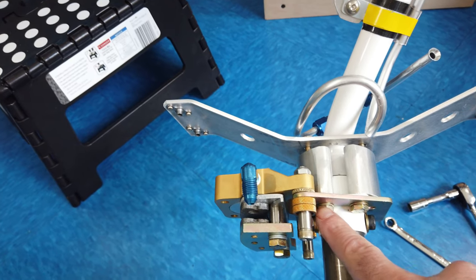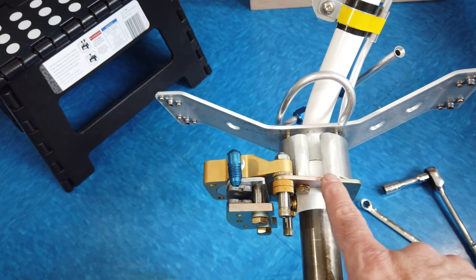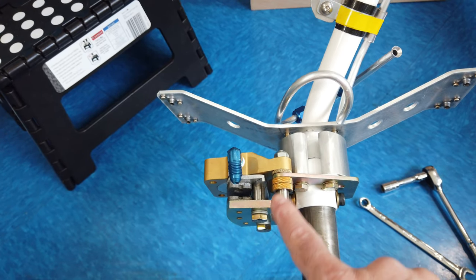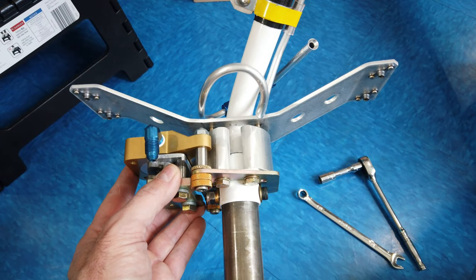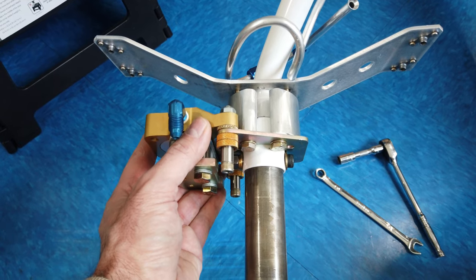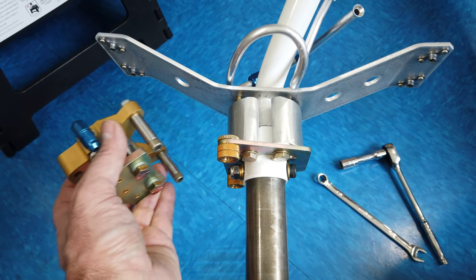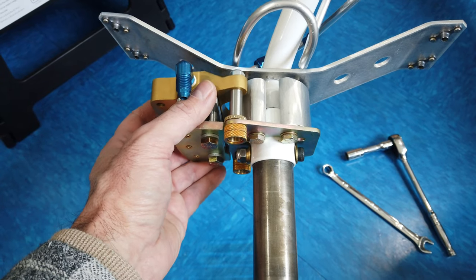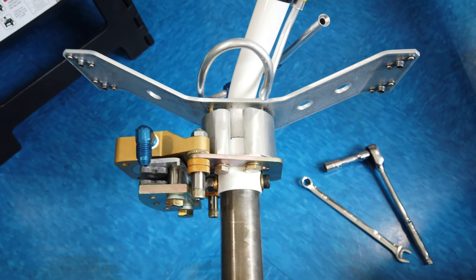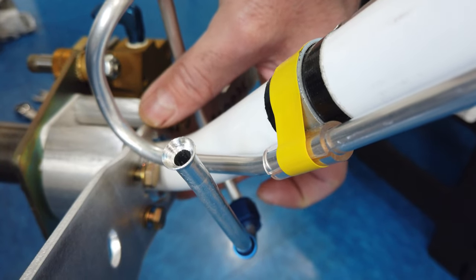You don't want to crank on these bolts to draw everything tight and end up imparting a partial tweak on this bracket. Just make sure that your caliper slides nice and easy with no binding, and you should be able to fit it in. As long as this back bracket is loose, you should be able to fit this in nicely. Then from the back side you can go ahead and tighten these bolts for this bracket.